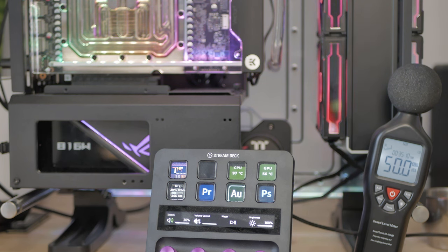If you can reduce the heat or increase the time it spends at a higher spec while at 95 degrees, you will squeeze more performance out of it. But it does run hot, and that means it will heat up the entire loop. At the end of the day, the 7950X will throttle if it goes above 96. You can obviously turn that off and let it burn itself out, but preferably don't do that.